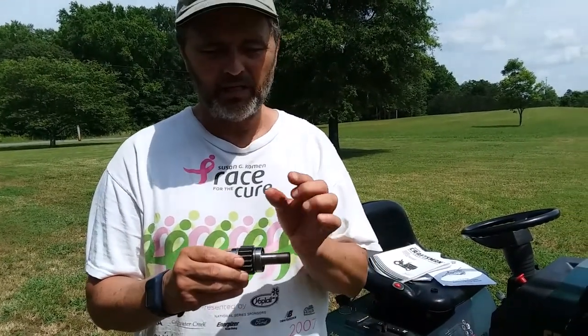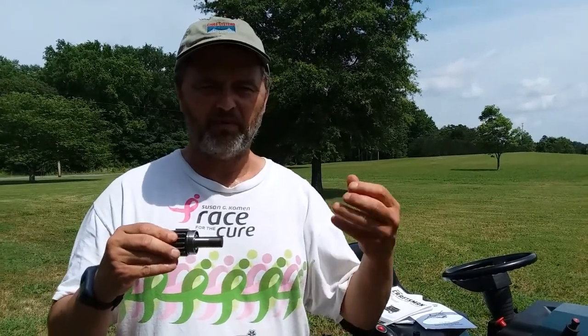Once I got it split apart, it only split a little bit, but it didn't seem to want to come apart. I thought there was something holding it, but there wasn't. There is just a lot of suction, and of course you want to drain your oil out before you split it apart. There's a lot of suction from the oil on the end places where the gears mesh into the two halves. It's an amazing amount of suction there. So if you slowly work around it with a very large flat screwdriver, so you don't gouge anything, that suction will finally give way and you can split it apart.